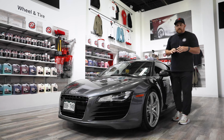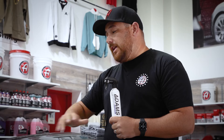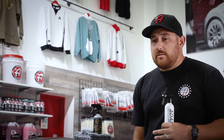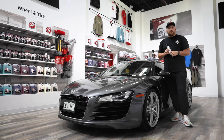If you need to clean your trim first and it's oxidized, use tire and rubber cleaner. Clean your trim thoroughly first to remove the oxidation, then you can get into protecting it. Third, consider using surface prep before you apply this. Surface prep is designed to remove any leftover residue from drying aids, polish, or trim cleaners like tire and rubber cleaner. Surface prep is always best practice for any of our protection agents, whether it be a regular ceramic coating or our graphene ceramic coating advanced.